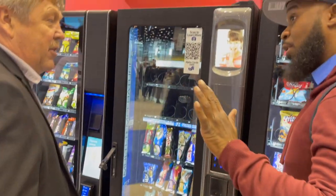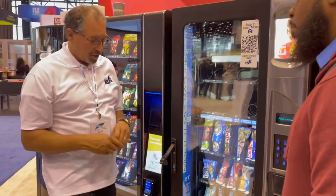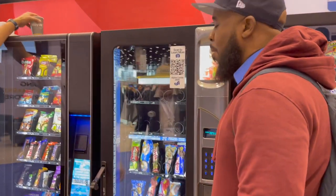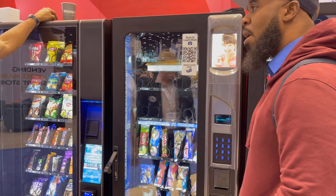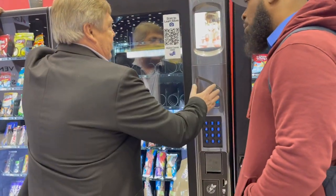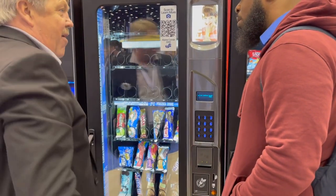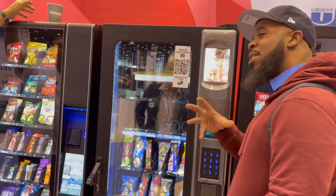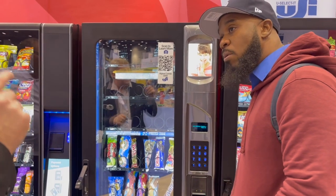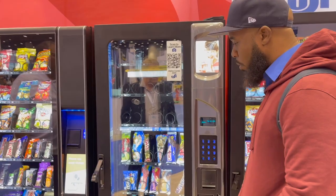Bear in mind, this is a 12-year-old machine. It's probably what's going on. It's out of level. That's all it is. It's not even the ramp. As it goes up, the cabinet's flexing and it's pulling this side down, and it's wedging. Once it wedges, I've been operating that door the same way. If they move the machine this much, it can make all the difference in the way the cabinet sits. I guarantee you.